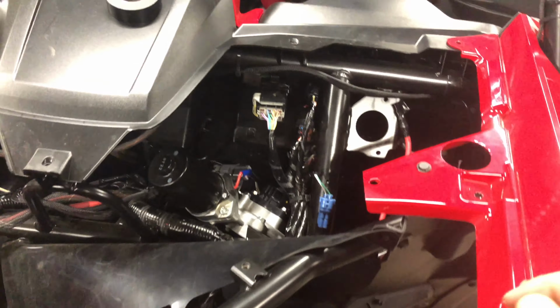You've seen that already. Then for these rocker switches, you don't have to have, but you can have 2 grounds, a constant power, your lead to go to whatever your accessory is, and then also accessory power. If you do all that and wire it separately, you can have essentially where you turn the key on, the lower light of the rocker switch will light up. You can see it at night. It's just a little nicer looking. And then when you turn the switch on, the top will light up. So I'm doing the full setup because I want the accessory light.